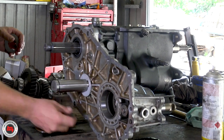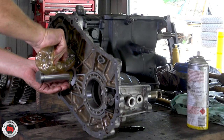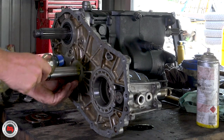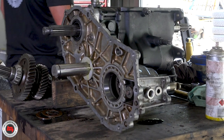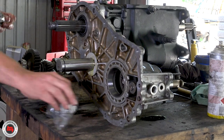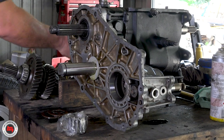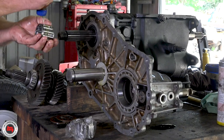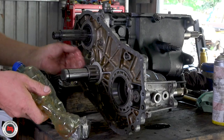There's a keyway there — really important to get this right because otherwise you'll crush the keyway and they'll just start spinning in there and you'll get premature failure of this thrust washer. At the end of the day, a thrust washer is just a spacer to hold the cogs in the right place — in this case, the needle rollers inside the transfer gear. If they can move, they can wear too fast. There's a lot of pressure on these thrust washers, as you can see from how the old washers have worn out. Is that because it's a helical gear? Exactly.